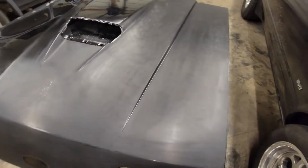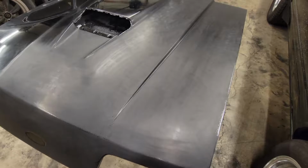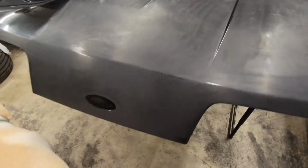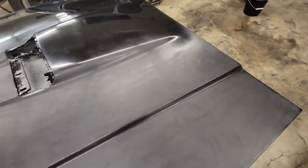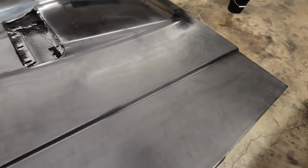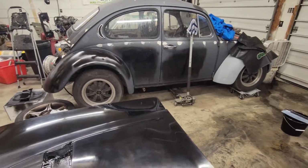You can see everything is sanded down. All this is sanded down between 800 and 1,000 right now. And the front, I just went over some 1,000. It's not perfect. I mean, you can see little places like this. The first layer of this did not go down very well. Some of that was my fault with the paint, and I think the fiberglass takes a little harder than steel, because I tested it out on the side of the bug over there and it went on just fine.